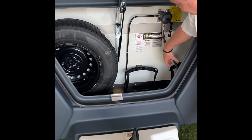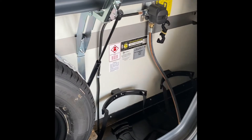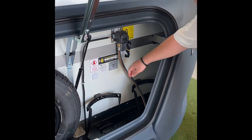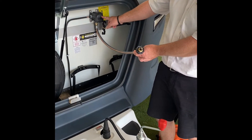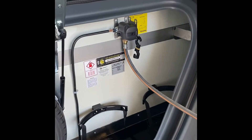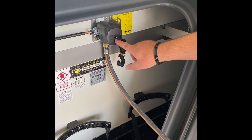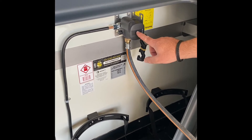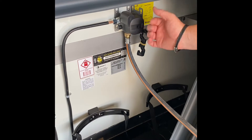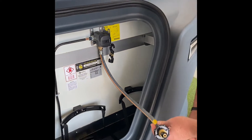In the gas locker there's a spare wheel fastened on by a little fastener, and there's space for two gas cylinders. We normally recommend six kilo. The gas hose is fitted to the bulkhead regulator just here. You get a little black tool and a little tester — it should always be in the flush position. If it's popped out, use the little tool to turn it and pop it back in.